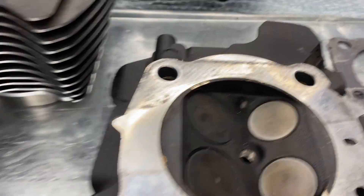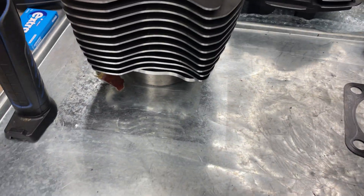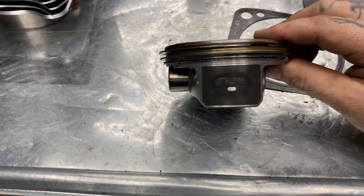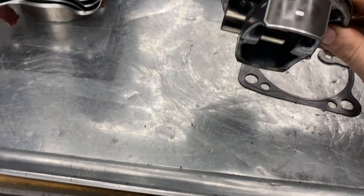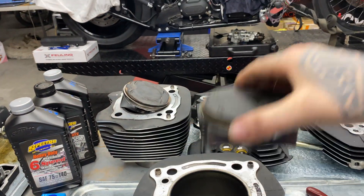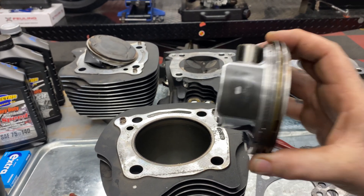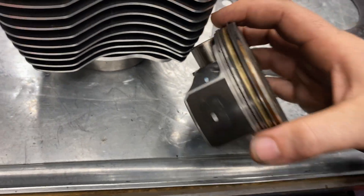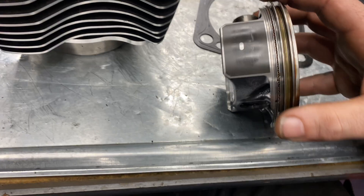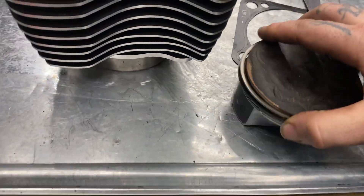If there was an incorrect tune or a bike operating hot, we would definitely see piston skirts scored and damaged — abrasive to the cylinder wall. When the piston is going up and down through thrust motion on its skirts, if we have heat expansion we would see that go further into a damage zone. The rings in the ring lands — because material debris has been picked up off the cylinder due to heat expansion — we would see the rings stuck in the ring lands. These things show evidence of heat.